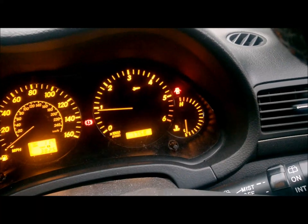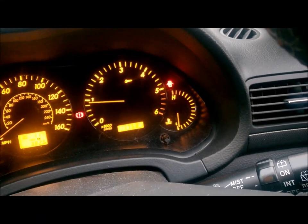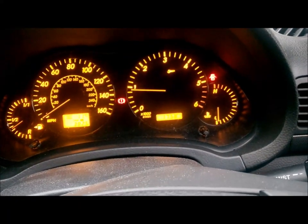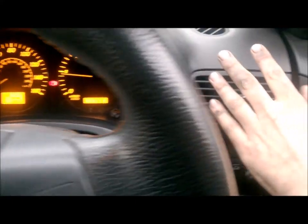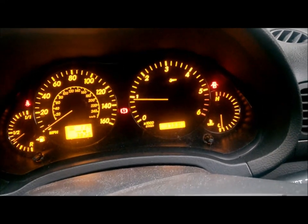So now we're running at tick over for a little over 10 minutes. According to the instructions on the front of the bonnet, as you can see it's just starting to come off the cold now and we're starting to get a bit of heat out of the air vents. I'm just making sure there are no airlocks in the system.